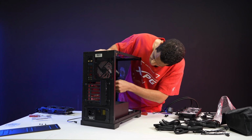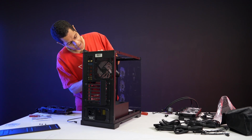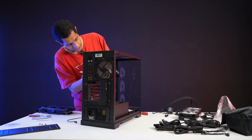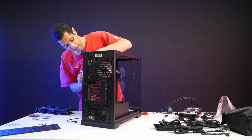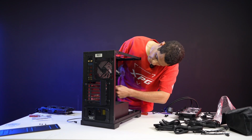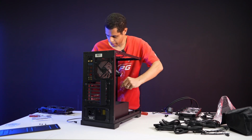All right, and then this one, you're going to go here, the USB 3.2. This also, I think I'm going to have to take out of the tie. There are built-in ties to the case as well. Like the PSU comes with 6 ties for cables, but then the case itself has 5 built in to make it an even easier process for you. So let me pull that down and then through here. All right. Maybe that was too far down, right?